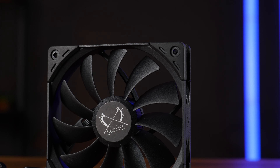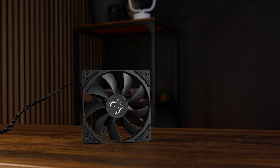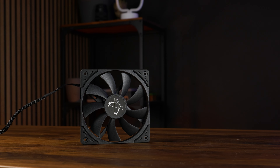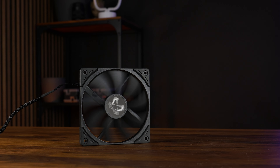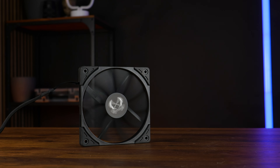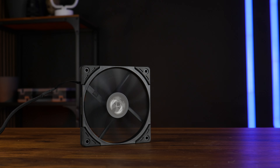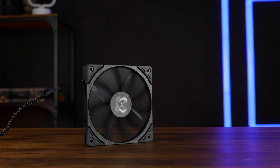But I'm not quite done with the slim versus thick comparison. Another very crucial change: instead of the impressive 11 blades we had before, we are now looking at 9, which is still kinda impressive given the thickness. And another one — while the thick one spins to the right when looking at it from the front, the slim one spins to the left. This really won't change anything; it's not like one direction is inherently better or worse than the other one if the blades are identical.